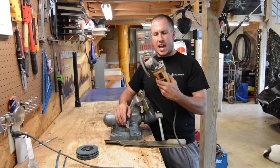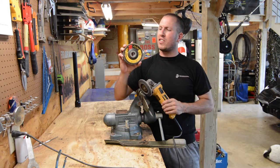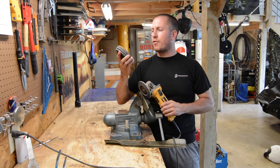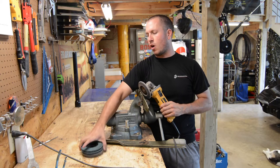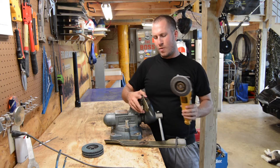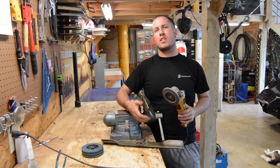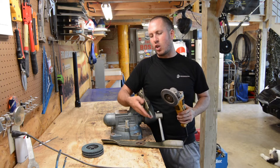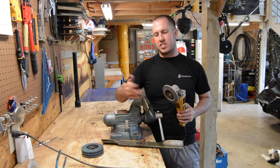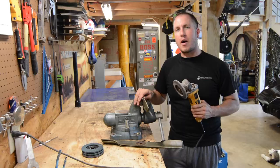The DeWalt grinder that I have — I'll put a link to everything I'm using in the description below if you want to check it out. I usually just have these delivered to the house because every time I go to Home Depot I forget that I need them, so I just put them on order and they show up in a couple days. It's quite convenient. There's really no method to the madness — you don't want to take off excessive metal, but you at least want to get it sharp to the touch. Some people say just a dull edge, but I sharpen them to where they're sharp on one side and just keep the same bevel every single time. I'll do a couple passes and then we'll go check out how I balance them.